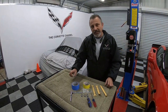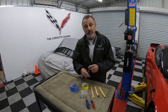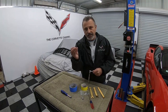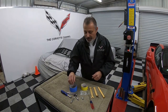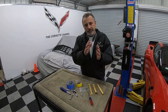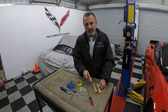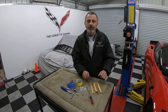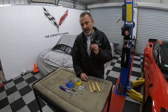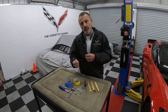You don't really need a lot of tools to do this job. You're going to need a 7mm socket, a 10mm socket, a T15 Torx, and a T30 Torx. You'll also need some masking tape to make sure you're not scratching the paint on the bumper as things start getting loose. We're also going to be using some nylon pry tools to get the bumper loose from the clips where it connects to the front fenders, and possibly a screwdriver to help get the clips loose when removing the old grille.